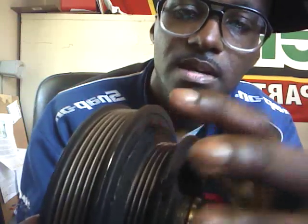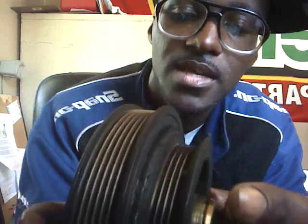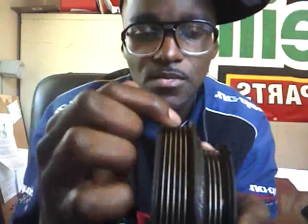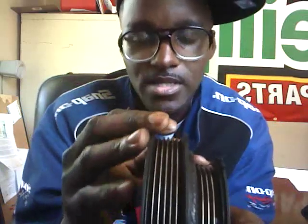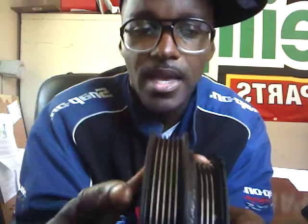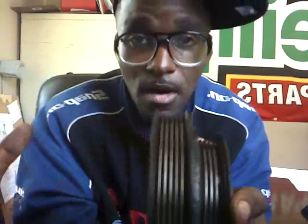When the rubber starts coming out, your belt that's running this pulley starts going sideways, and it starts to chip away or cause your belt to break. It'll eventually break. Sometimes I've seen where these two pulleys actually come apart from each other and the balancer breaks in half.